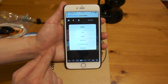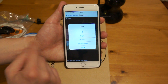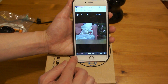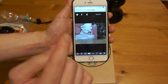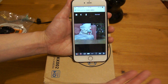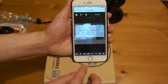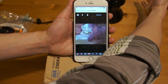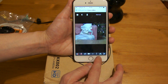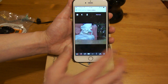On the right you can choose the video quality: HD 720p — choose the one obviously suitable to your internet connection, I'll choose normal. At the bottom on the left, the first button is audio coming in to the camera. The second one is audio being broadcast through the camera, so you can speak to the people in the room. The third one is to take a snapshot. The fourth one is video recording. The next two are the movement buttons. On the far right, that's the one to flip the image left and right and up and down — I rarely use those once it's set up.